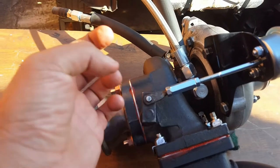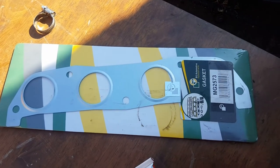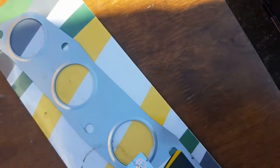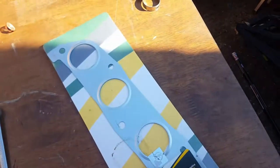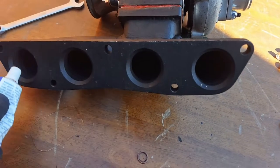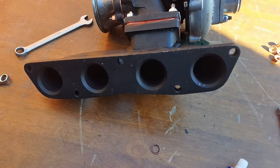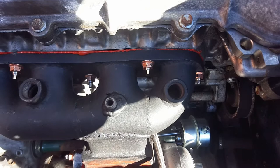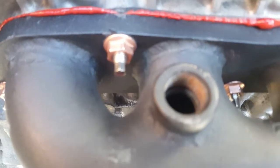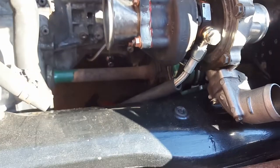That there is my finished bracket, all painted — looks kind of factory, I'm happy with that. The actuator is on; I haven't put the circlip on yet because I'll pop that off just to get the car started first. Now I think it's time to hang it. Gasket-wise I've got a brand new multi-layered metal gasket — just a stock one — good old RTV, put RTV on the engine, then the gasket, then RTV on the manifold, and tighten it all together. The manual says 37 Newton-metres of torque, so I'll give that a go.